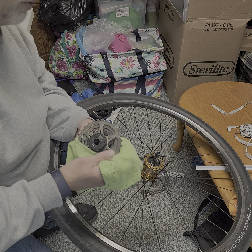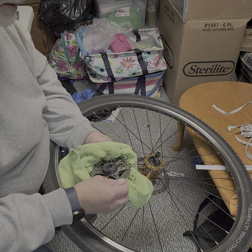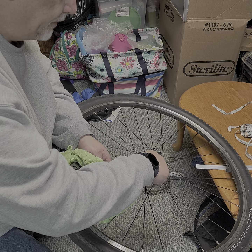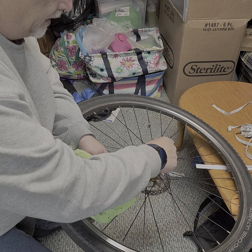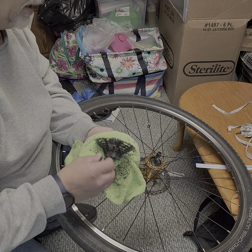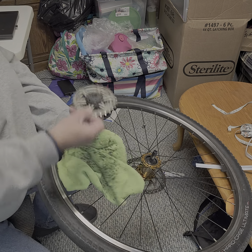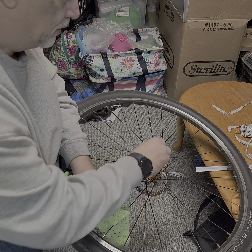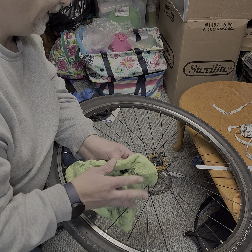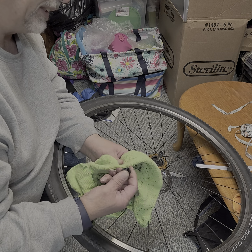There is nothing that holds this mechanism, your cassette body and ratcheting mechanism, to the wheel. This is an aluminum axle. You have your ratcheting ring in here. And the first thing you should do, this is 12 millimeters, and how they use this on a regular bike, when they move this out of the way, is they use a cone cup on the top of this that fits over the top of this that takes it down to the required 10 millimeters. This actually looks smaller than 10 millimeters. I don't know what size it is.